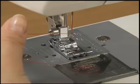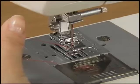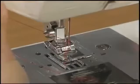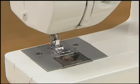While gently holding the end of the thread, raise the presser foot and slowly turn the hand wheel toward you once to raise the needle. Pull up the upper thread and the lower thread will come out. Pull out the thread with your fingers. Put the upper thread and the lower thread under the presser foot and pull out about 5 centimeters, or 2 inches, of thread toward the back of the sewing machine.